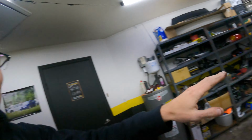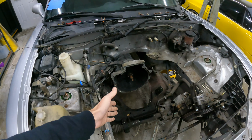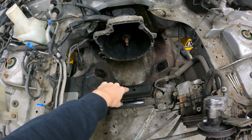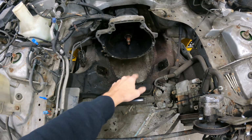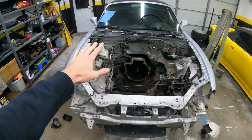So I do want to get some of these parts starting to order up, because I'm going to need the engine mounts and the skid plate. It would be super easy to do right now, because you can kind of see that U-shape I was talking about, but the skid plate sits right in there and bolts through the little lip on the edge and it's perfect. So that's really what I want to get ordered up.